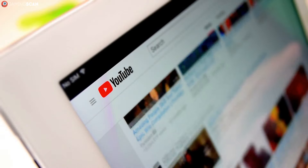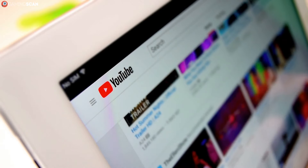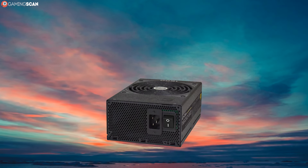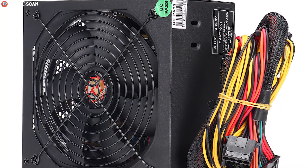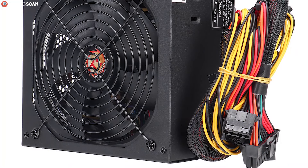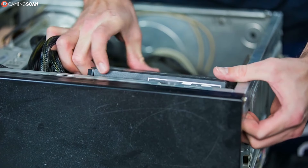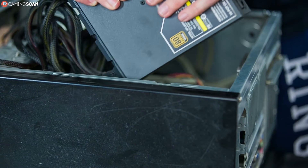If you're not sure what these terms mean, check out the video in the description where we go over all of the benefits and drawbacks of non-modular, semi-modular, and fully modular PSUs. Make sure to note down the modularity of your PSU since some models come in multiple varieties, which may differ in wattage. At this point, it's a good idea to either take a picture of the specs sticker or write the important bits down somewhere so that you don't have to go through this process ever again. All of this work was done mostly so that you'll know what the maximum power capacity of your power supply is.